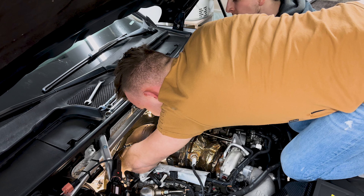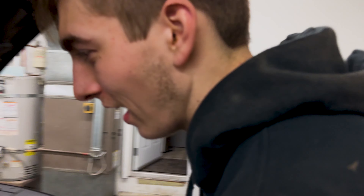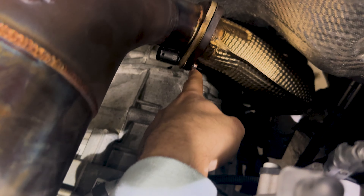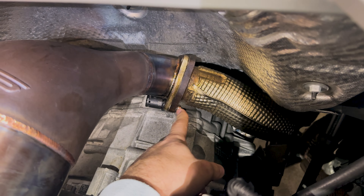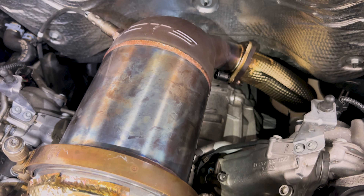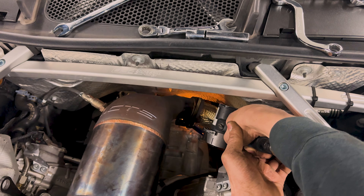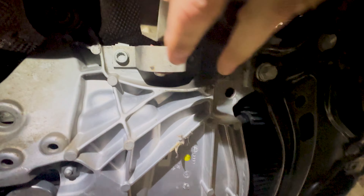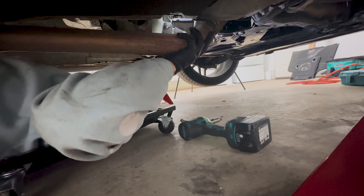There's the first exhaust section — weight reduction! We cracked each nut loose one by one. Take a look at this first brass bolt — it almost stripped on us. Here's what happened: one bolt is stripped, one is loose, and one is a goner. We tried a little belt sander and a grinder. We had put anti-seize on these when installing the downpipe and they still were nearly impossible to get off and sadly stripped. The belt sander made quick work of the bolt and nut, and before long all the bolts were out.